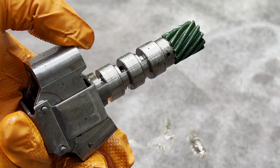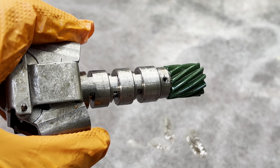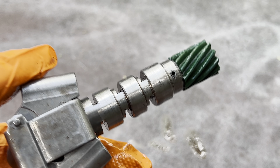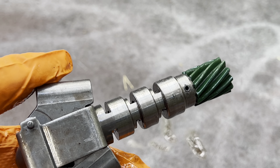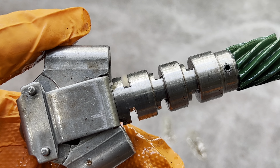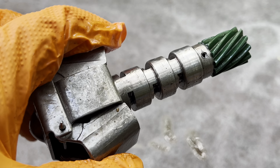I'm gonna clean this one up and stick it back in there, and I'll probably send that thing on to them. I'm gonna inspect it a bit more and make sure nothing's wrong with it or damaged. Pretty easy to uninstall. It's called the governor gear, and what this does is make the transmission change from gear to gear. Quick recap: if you're looking to uninstall this and the transmission is inside the vehicle, you go on the driver's side — there's a little circle piece.